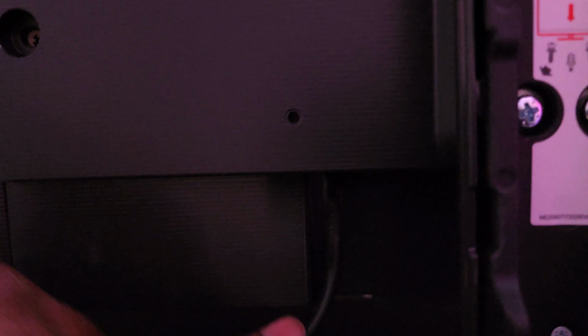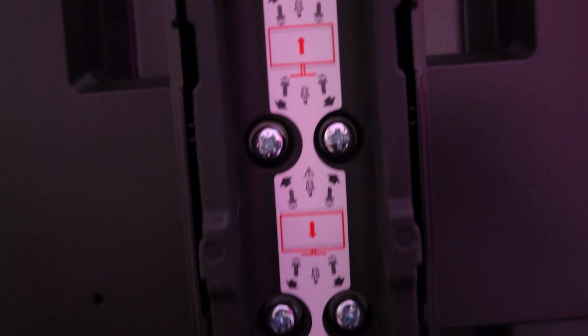You're going to take those hooks, okay? And you're going to put it in this hole here on both sides, and you're going to feel it line up. And when it lines up, you're going to feel it drop like that, okay? Now, once it drops, then you're going to make sure you pull your power cable out from underneath if you did what I did and lock it under there, right? So now I'm pulling the power cable out and I'm streaming it down through here, okay?